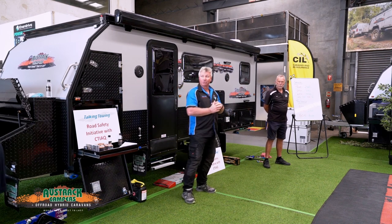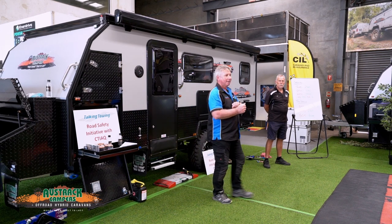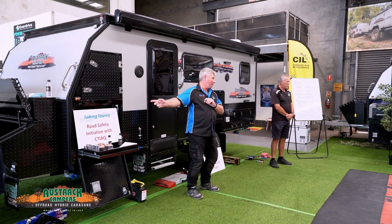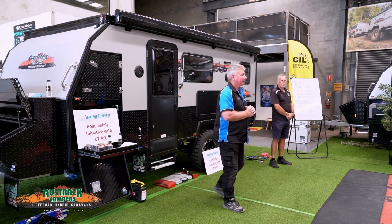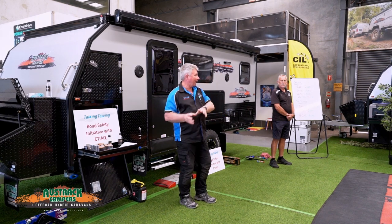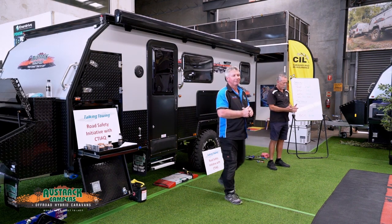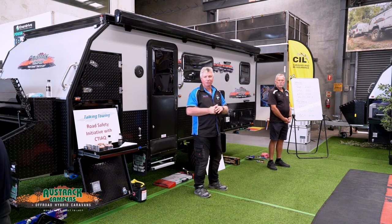If the trailer's not braking hard enough, you're going to feel it pushing. What else might trigger on the motor car? ABS brakes. If you feel that shudder, the trailer's not braking enough for its own weight — it's not assisting the motor car on the braking. Unfortunately, you do have to trial and error this yourself; I can't give you a setting. Weight, efficiency of wheels, the physical weight on the wheels, and the speed we're going are all determining factors, as are road conditions and even tyre pressures — if they're not right, the tyre's going to have a different grip.